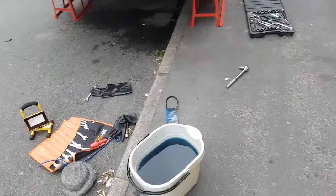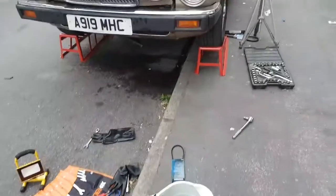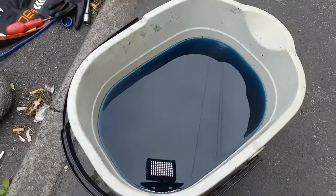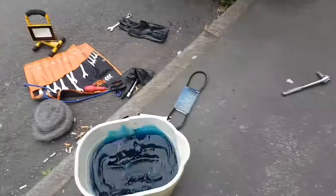Changing this fan belt — actually it's not a fan belt, it's an alternator belt — is proving to be a bit of a nightmare. This is my brand new fluid, it's the coolant. I've had to let the coolant out because it's close to impossible to get any access to the alternator or the nuts to loosen it without first doing so.